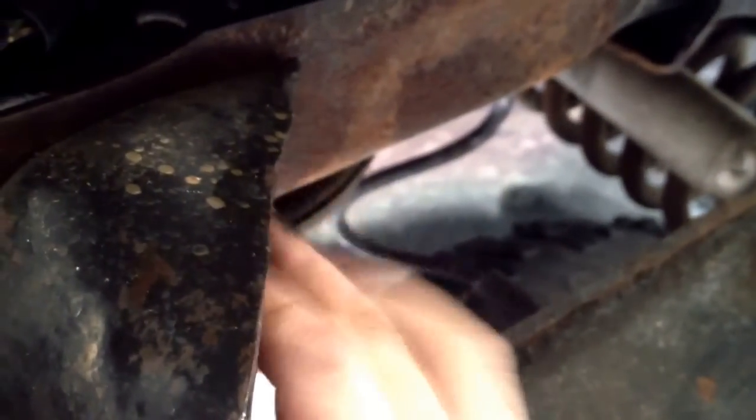This is what the other side of that bushing looks like on the other side of the bracket. On this side there's a big nut — I used a one-and-an-eighth inch socket to take that off with my impact. There's a bolt up here that I got off, and there are a couple other bolts on this side. The problem is, on the other side there's a nut on the inside of the frame, right next to a very fragile, brittle brake line. So you've got to be careful — I'm going to put a wrench on the inside of the frame to hold the nut in place and use the impact on the bolt head.